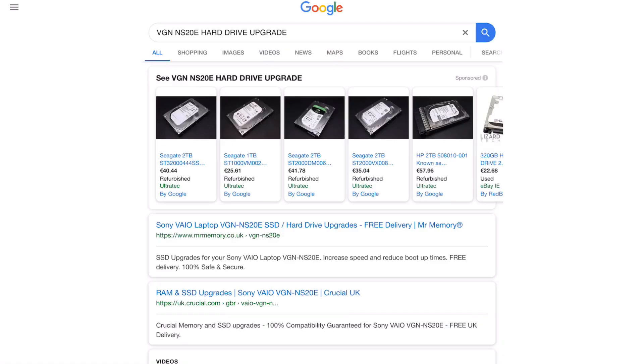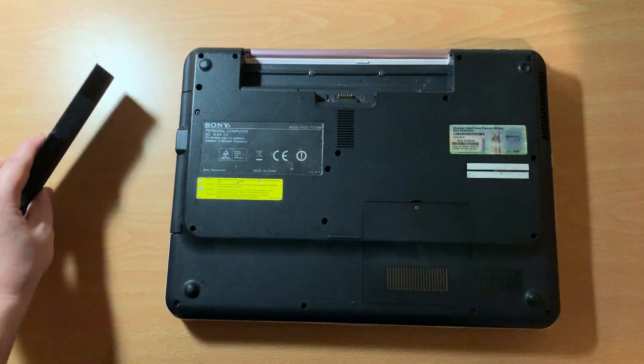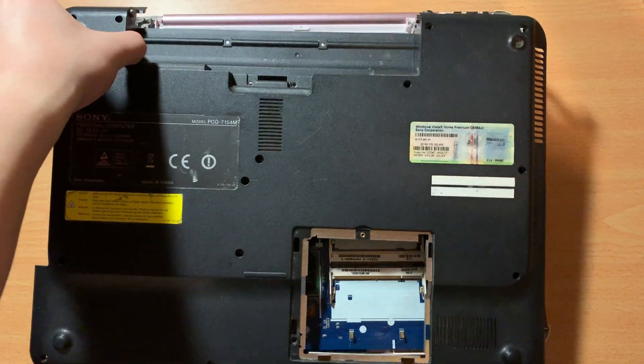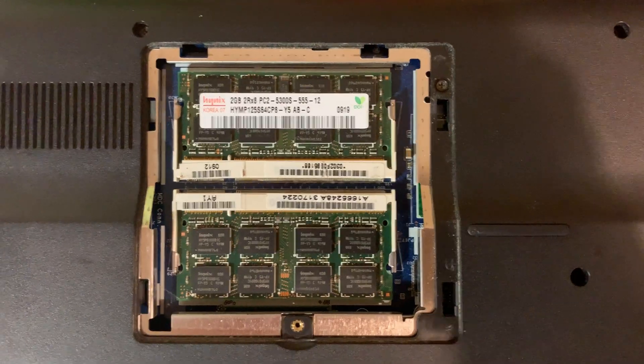With a lot of Windows laptops, there won't be instructions on the internet on how to upgrade, unless you get lucky with a YouTube video. Many older PC laptops do have memory doors that allow easy access to upgrade the RAM. Before buying new parts, disassemble the old laptop — since it's an old laptop, you don't mind if you break it anyway. You need to make sure you're able to perform the upgrades and confirm you're buying the correct memory and hard drive for that laptop model.